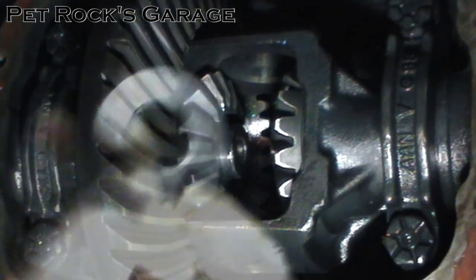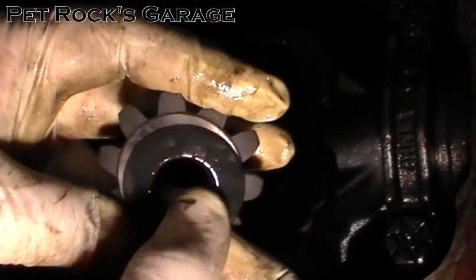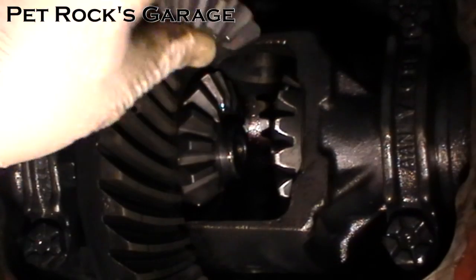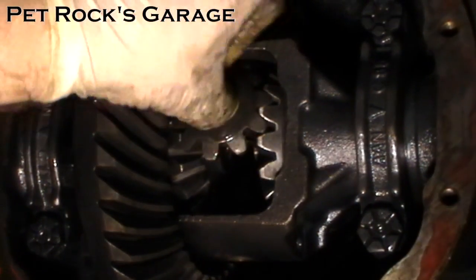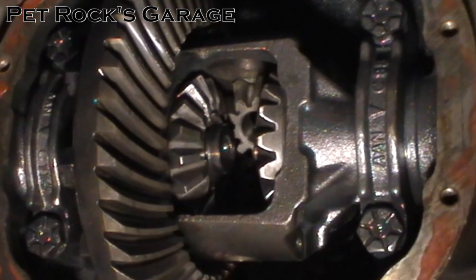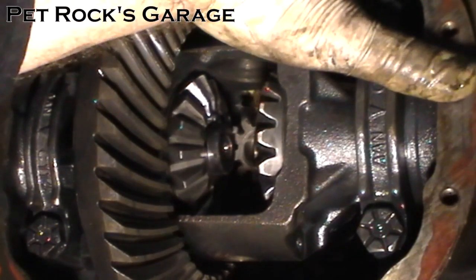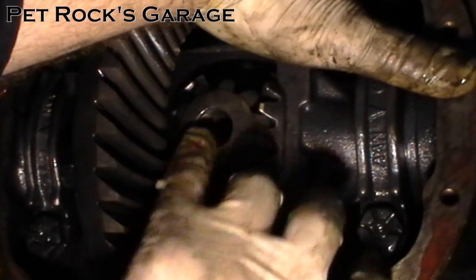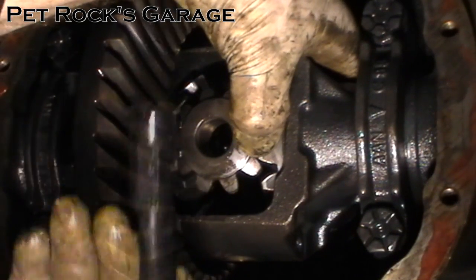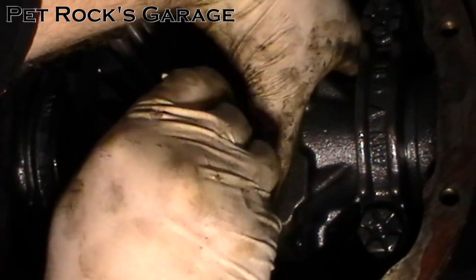Like with the side gears, you need to take the washer that comes with it and coat both sides with a little bit of oil. Then you take the washer and stick it on the back — it should hold itself there based on its own spring pressure as well as the oil you applied. Take your top spider gear, line it up within the gears, then rotate it into place so it's all the way in the back without falling out. Then stick your hand through the back and rotate the entire assembly holding the top spider gear in place. Then take your bottom spider gear, slide it into place — this lets you align both halves and still manipulate things so you can put the center pin in place.